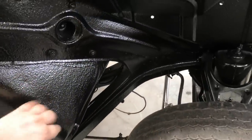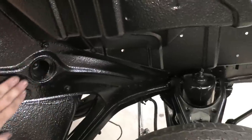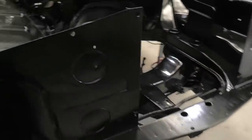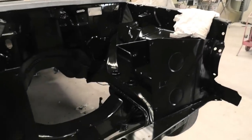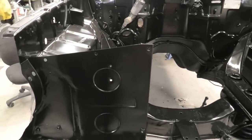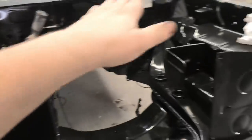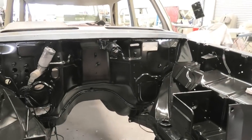Apparently I've picked up a few dents over the years that I didn't notice. I ran some seam seal through here, down here. There is trash in the paint, but when you're painting in not a spray booth and painting black of all colors, you're going to get trash in it. It's ironic - it's actually only in the flat surfaces. Whereas the firewall, there's not a drop of trash in it - typical. Because it's a vertical surface, dirt can't really land in it.